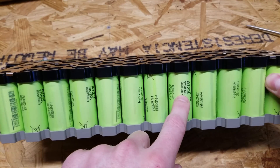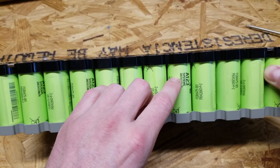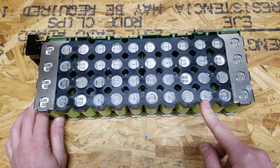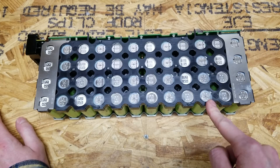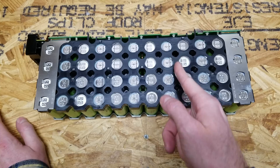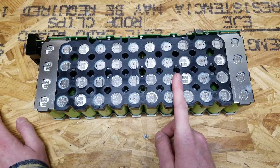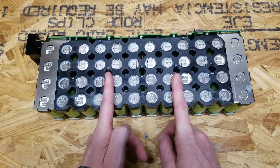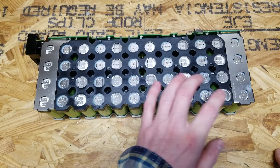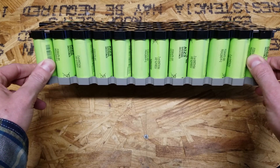You can see these are the A123 system cells — model number ANR26650M1B. Considering these cells are already wired in 4P, you could split it after every four cells. If you cut straight down at certain points, you would have 12-volt batteries already wired together. So really you can make a couple of cuts and have individual 12-volt modules. However, I want to retest all these cells, so I'm going to rip it apart — and most of us are using larger battery banks closer to 48 volts anyway.